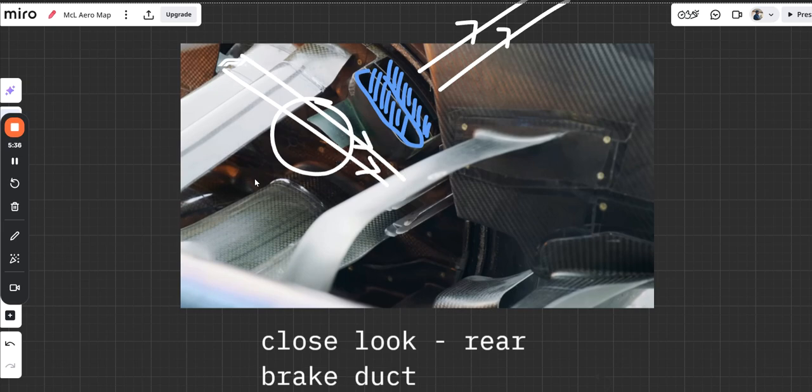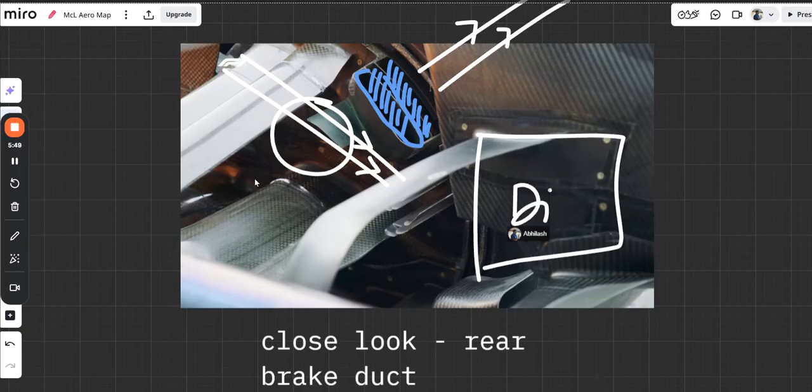So what happens is that when the flow comes out of that duct, it will integrate with the flow structures. And note, where is this in close proximity to? Note that this part is the diffuser edge. If you were to send out hot air close to the diffuser edge, and you were able to successfully push it towards the downward vane, which would essentially make it load generated because of hot air you did not get through the floor and you just got it from outside. That would mean you can manipulate your entire on-body aero to send hot air directly to your rear axle, which would push it forward and essentially make it a free downforce point. You can now use on-body aero even more.